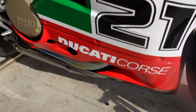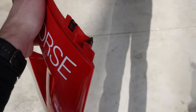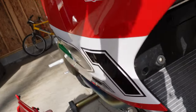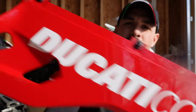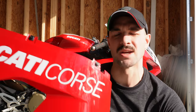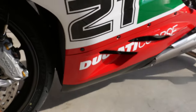This side should be free and loose. Do not forget the little bolt on the inside of the fairing — there's a little nutsert there where the fairing tucks up into the upper fairing and they bolt together on the back side. Don't forget that one. Lower fairings off on one side. I like to put all my hardware back where it came from while I'm working on the bike — keeps things organized. There are some plastic washers too, so you avoid losing those.